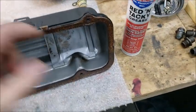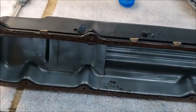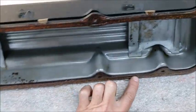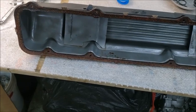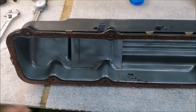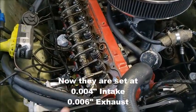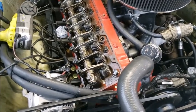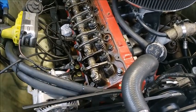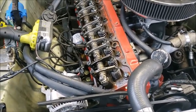For those of you fortunate to get a Slant Six Daily Garage load spreader for your valve cover, here's a little pro tip I didn't include in the last one: put a little grease on the load spreader. It just eases popping this thing back off. This thing spreads the distribution so well that it gives a nice even loading in the corners, and this way you can pop it on and off easily. I pop mine on and off quite a bit more than probably anyone else because I'm always experimenting with different lash adjustments. So I just lashed them to four and six.